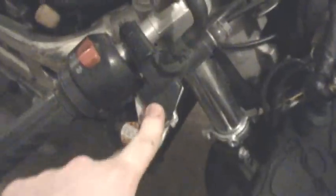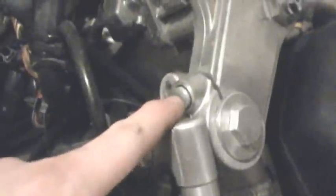What we're going to do next is loosen all the bolts to the controls and remove the bar end. The front brake is going to stay on. We're also going to need to loosen up the top triple — there's a bolt on each side, and you loosen the center bolt in here for the steering stem. So we're going to get that out of there as well.